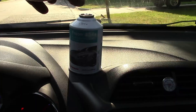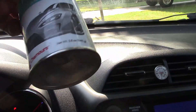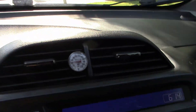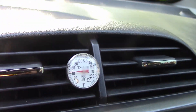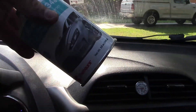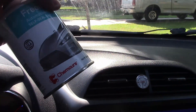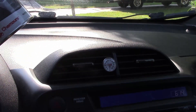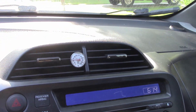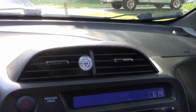I hooked it up to add a bit more and the can ran dry — I went through 12 ounces of refrigerant to reach this just-above-40-degree temperature. The gods of R134a blessed me by only selling 12 ounces at a time, so I couldn't overcharge the system, force liquid into the compressor, and destroy it. The car is now capable of feeling very cool even on a 100-degree day and can keep us alive when it becomes 110.